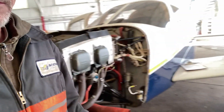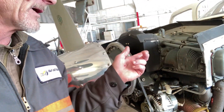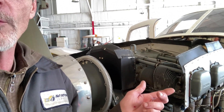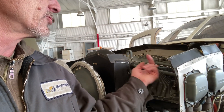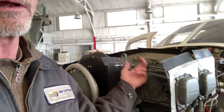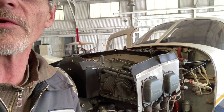Here's my final take: number one, teach your students, kids, and staff proper fuel cap usage — push down, don't just grab and turn it. It's filling your system with metal. Number two, check your fuel screens, especially the one in the throttle body, and hopefully that'll fix your problem. Finally, if you take a fuel injector line loose, remember to comply with the AD note on the fuel injector lines. Thanks for watching, have a great day — hope this helps.